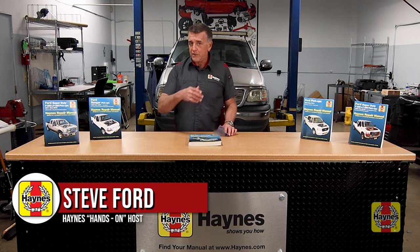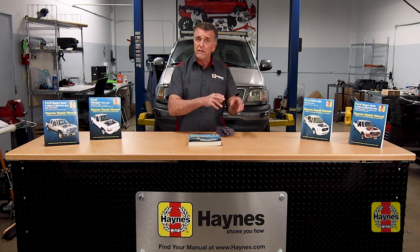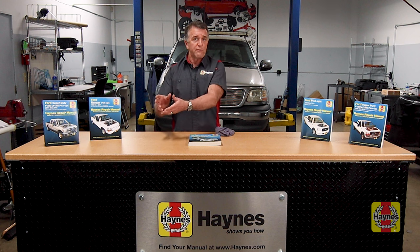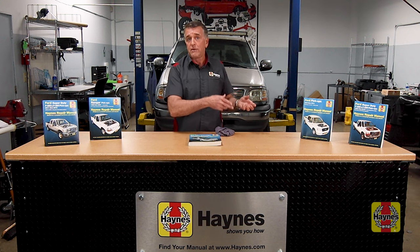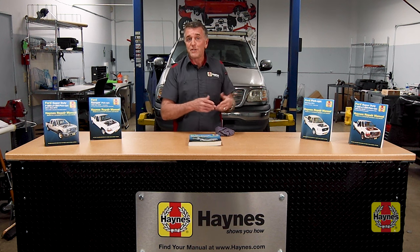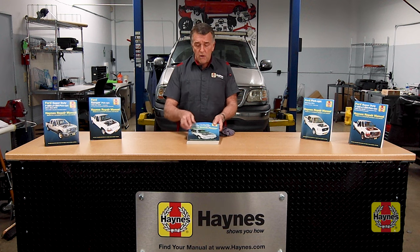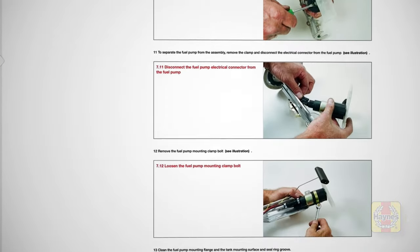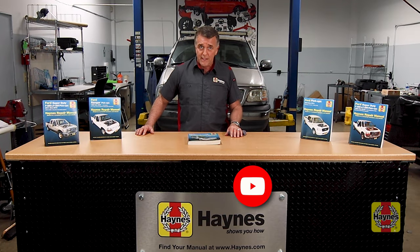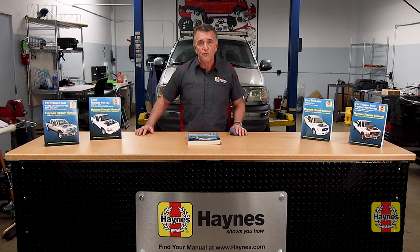We isolated the electric fuel pump by the procedure you just watched: we went into the cab and validated a crank but no start; we had starter, battery, and electrical power to the relay; we had spark operating to the coil pack; and no fuel pressure when we checked the fuel rail. That led us to the fuel pump in the back. We confirmed good power and ground, which isolated the fuel pump as not operating even though it had power and ground. Along the way, we put in a fresh fuel filter to be sure the vehicle is completely ready to go. That shows you some of the basics and steps you can go through based on what's in the Haynes manual, either the print version or online at Haynes.com — you can subscribe for a lifetime subscription with instant access. Thanks for watching; please subscribe to our YouTube channel and follow us on Facebook and Instagram. I'm Steve Ford — we'll see you next time.